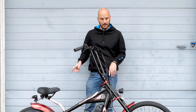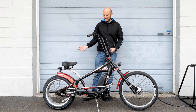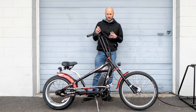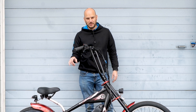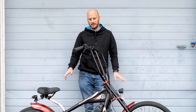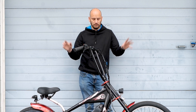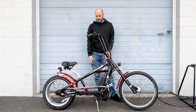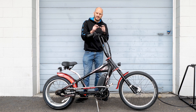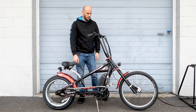This will blow any hub motor out of the water. I know a lot of people ask why not just go with a hub motor if you're doing single speed — it's because if you go with a hub motor, you're stuck in one gear ratio. You cannot change it unless you take apart the entire motor and change the windings, which you're not going to do. With this, you just swap out a chainring or the rear cog and boom. We were able to reuse the chain ring, just had to put some spacers and washers to bump it out a little bit — totally doable.